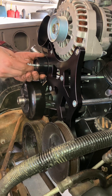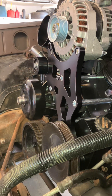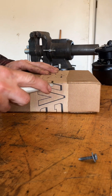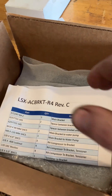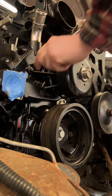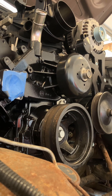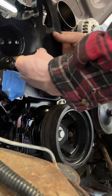The last thing to do with this bracket is installing your idler pulley, then torque it down and install the cap screws. Now we can move on to the AC bracket — go ahead and open that box, get it unpacked, and lay out the bracket and hardware. The bracket will mount in three locations; that bottom bolt will need to be removed from the water pump, so go ahead and get that out now. Install the bolt and spacers through the bracket and then head over to the engine to install the bracket into its location.